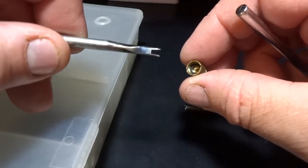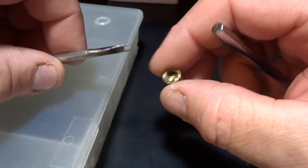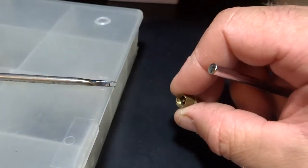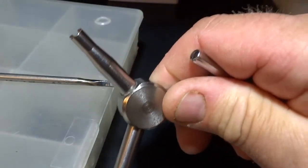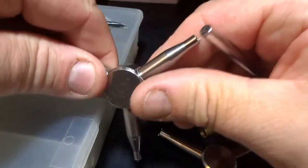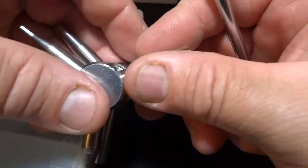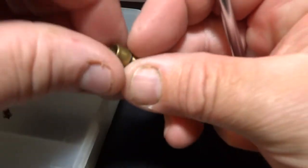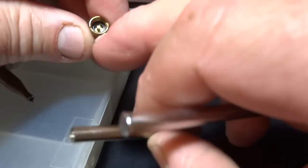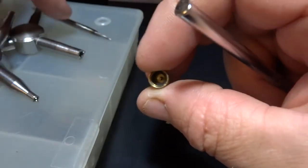This is the cheapest way to go but it takes some time to get it right, because you want to make sure it mates up with the inside of that valve or you can strip that brass out. Or you can get online and buy these little tools — I got these off eBay. You buy them by the set and it's like 50 bucks. This really comes in handy because some of those valves don't come out easy, and you want a solid grip before you turn it. If you strip these little notches, you'll never get that valve out.